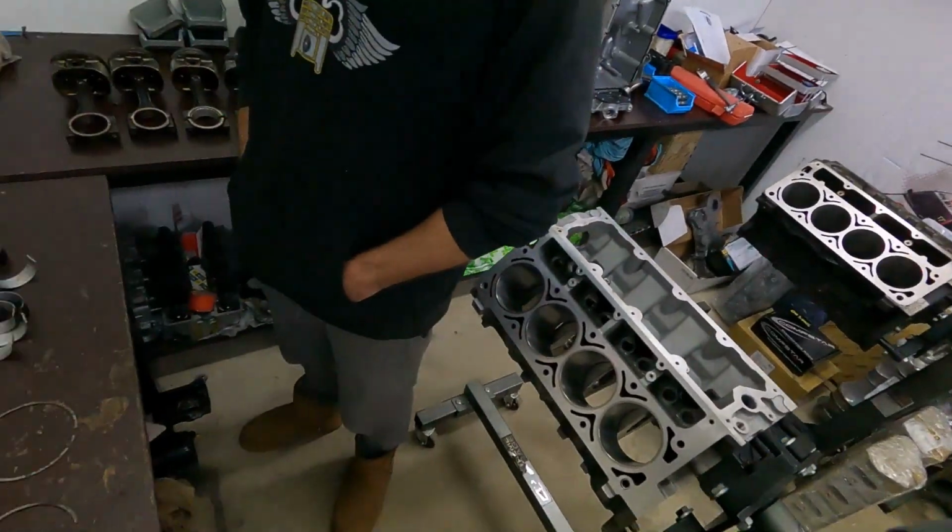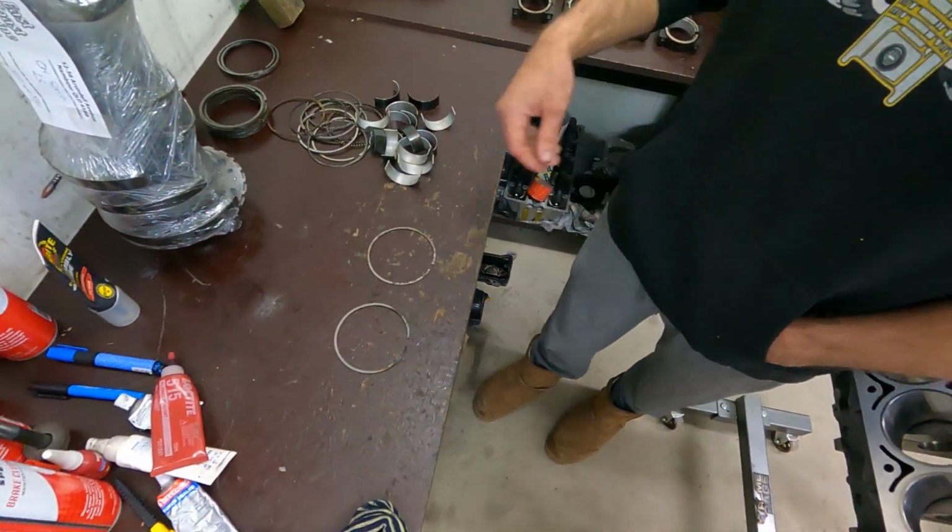It must have had water or fuel. Generally it's a hydrolock which will bend a rod, because as we know, fluid doesn't compress like air, and if you get a pot full of fluid that can't go anywhere, you end up bending a rod. So that's likely what happened, and Rex has found evidence on the rings off some of the other pistons that it has had water in it.